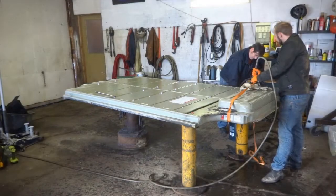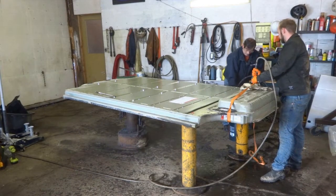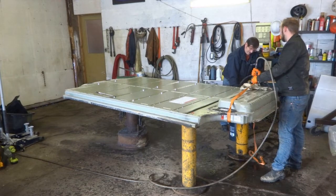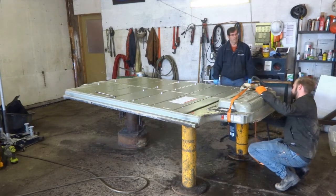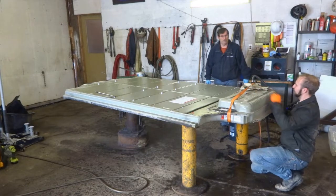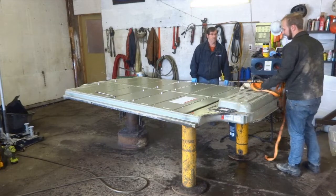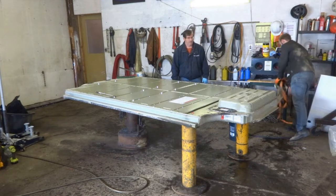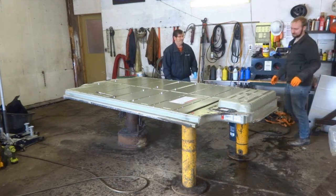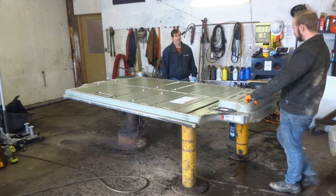The coolant that Tesla uses is called G48, and it's the same that Mercedes uses. So if you need to refill your coolant, you just go to Lordco and ask for Mercedes or European Blue, and it's the same stuff. It uses just a battery heater off the high voltage system to heat the coolant when the battery is too cold, which up north here is most of the time, because the battery likes to be above 10 degrees Celsius. So most of the year it's too cold for it. Yeah, so that's why you hear a little noise when the car is just outside, freezing cold. The little coolant pump is going, right? Yeah, it's keeping the coolant pump and the heater going.